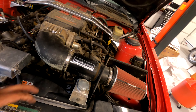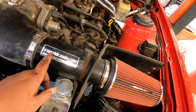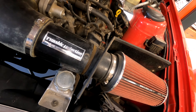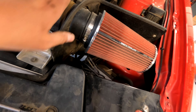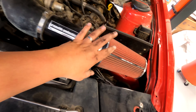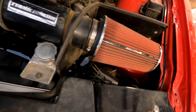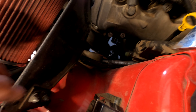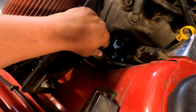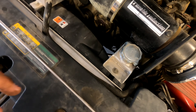This car's setup is a little different than yours probably - you're gonna have a factory air box and all that stuff. You're gonna have to remove that. I'm just gonna remove this and tilt it up out of the way because the thermostat housing is down there. If you have a factory air box, I would probably say remove the whole factory box because this hose here needs to come out straight up vertically. I'm even gonna have to take this heat shield off and disconnect it because it's in the way. So yeah, remove your intake to get to the thermostat housing area.